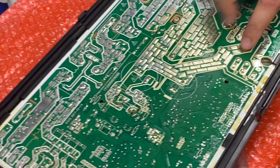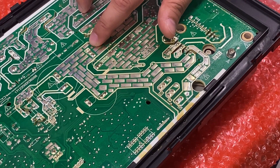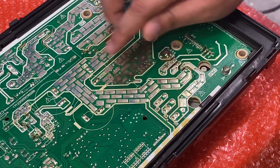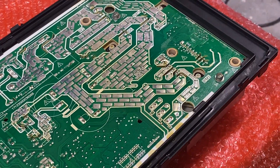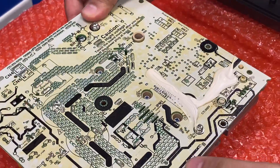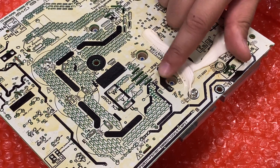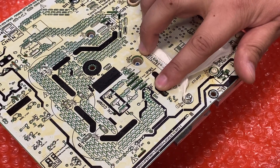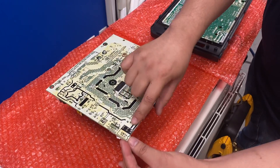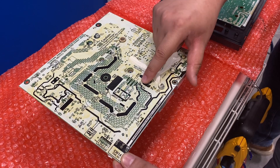To check the unit, locate W, V, U, and P. With your meter, check between P to W, P to V, and P to U, making sure all values are the same. Do the exact same thing for a standalone IPM board — locate W, V, U, and P, and check P to U, P to V, and P to W. It doesn't matter where on the board you check; for instance, U, V, and W points can be checked between those points as well.